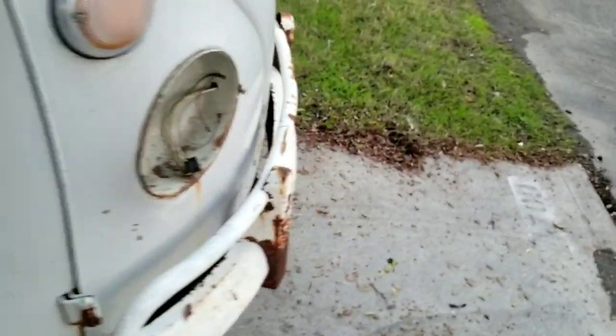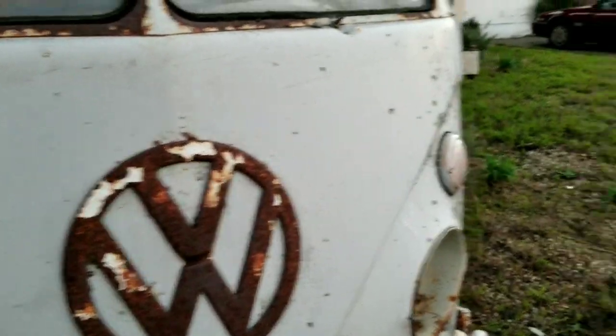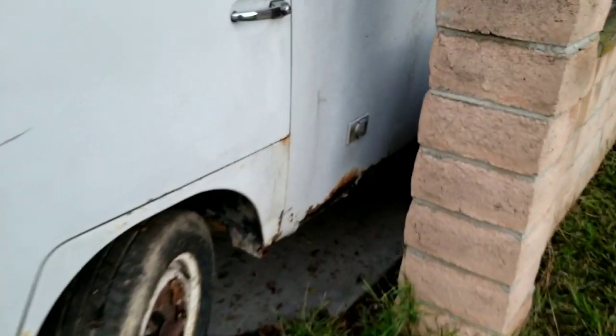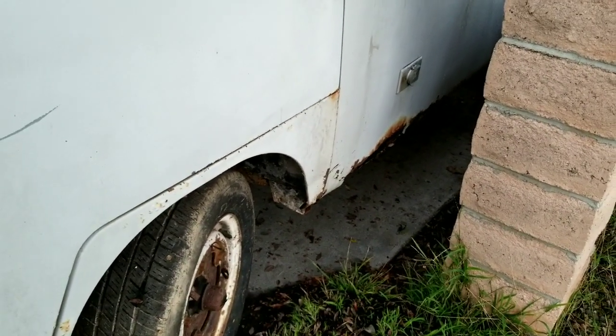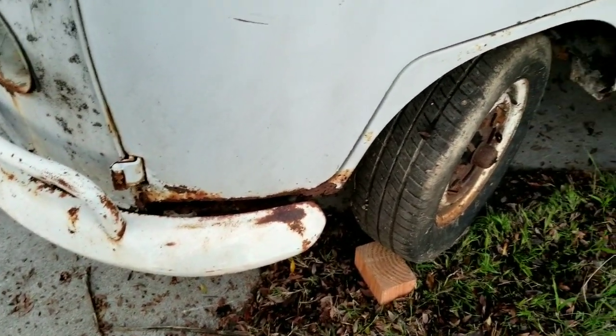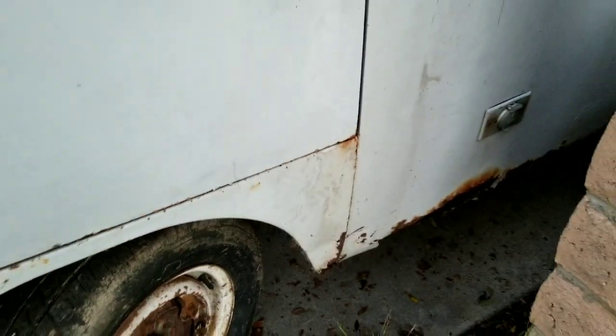It's totally saveable. Look at the front — it's not too bad, pretty straight. The vent rust isn't too bad but it's got roof rust right here, though it's not going through. It's pretty solid compared to the ones back east. It still has the electrical outlet. The '67 has integral backup lights and it's 12-volt from the factory — that's what makes it kind of special. Dog legs are pretty bad — maybe I'll do the dog leg replacement, that'll be a good video.